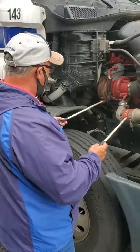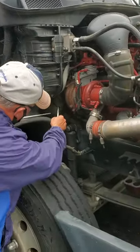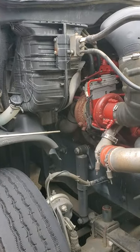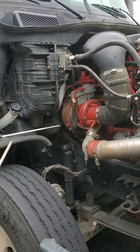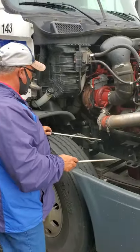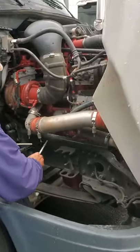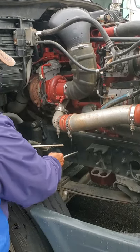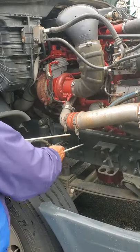On this side, since I'm looking at it coming out of my turbo, I'm going to check my exhaust. Make sure there's no cracks, no damage to my exhaust, no black soot indicating a carbon monoxide leak. While I'm here, I'm going to check my frame. Make sure my frame is secure, no holes, no cracks, no illegal welds.